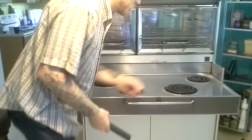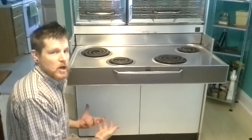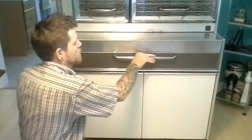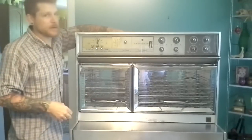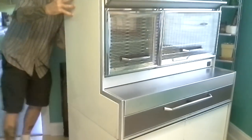If you need to service the burners or the latch that pulls this drawer out, there's a panel underneath the stove. A couple of screws come off — the whole drip pan down here comes out in one piece, and it has your model number and serial number, and allows you to access the burners. Another quick service tip: you have two screws on top of this aluminum trim — that piece pops off and slides out, and you're able to access all of the controls behind this glass from up top, just like popping the hood on a car. On the back there are two big black panels that are your main service panels. They unbolt, and if you need to put a new pigtail on or access your electrical components, you have access through those back panels.